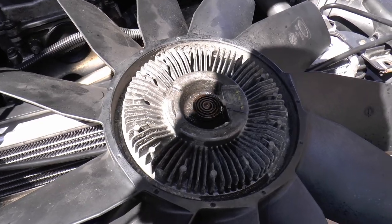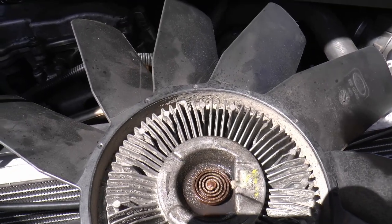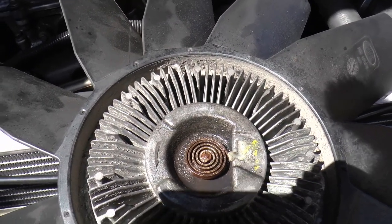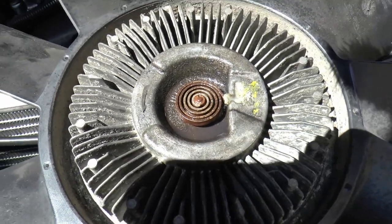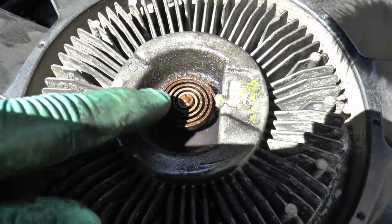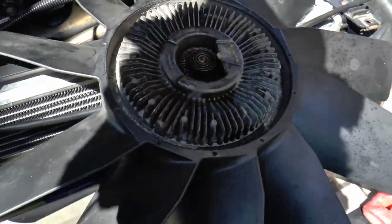Anyway, to look at a proper video on that, go to Britannic Restorations. It's a chap called Mike, he's from Yorkshire, but he's in Canada. And he normally does 110s and 90s and all sorts of stuff, but he's very, very good. And it was him that put me onto this. So there you go, that's how your viscous fan works, because I never knew that. It's all about that bimetallic spring winding up, turning the valve, job's done. Awesome. Right, so I'm going to pop that back on.